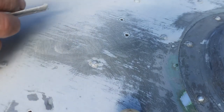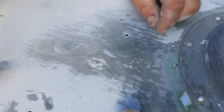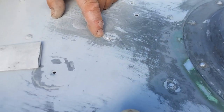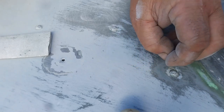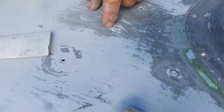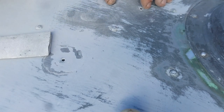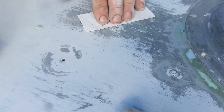As I'm hand sanding around the spare wheel securing disc, I'm looking at each of my rivet heads and seeing different problems with each. We've got starring in the paint here, which means the paint has moved and cracked. We've got dirt inclusions on this one. One a little further back has a really deep flake because when people have painted it they haven't rubbed down properly around here. That means I'm going to have to take all of these back to sound paintwork. Each one has its own challenges. I don't want to go mad with the orbital sander and sand off the tops of them, so I hand sand around all of them — sanding in towards the rivet all the way around.